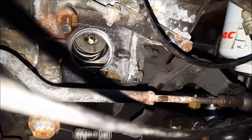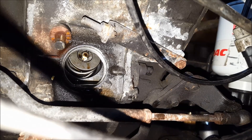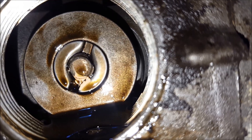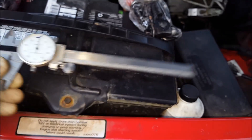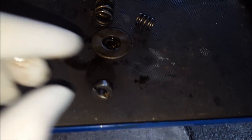Make sure to put a pan under the truck because it does leak some oil out. Now I can see one of my springs, but you're going to want to rotate the engine until it's properly located, then take a vernier caliper. After rotating the engine and positioning the spring properly, measure the distance between the center stud and the slotted retaining fastener — that should be somewhere between 40 and 50 thousandths of an inch. You need to measure that before removing it, and when you put it back, it has to be set at the same spec.